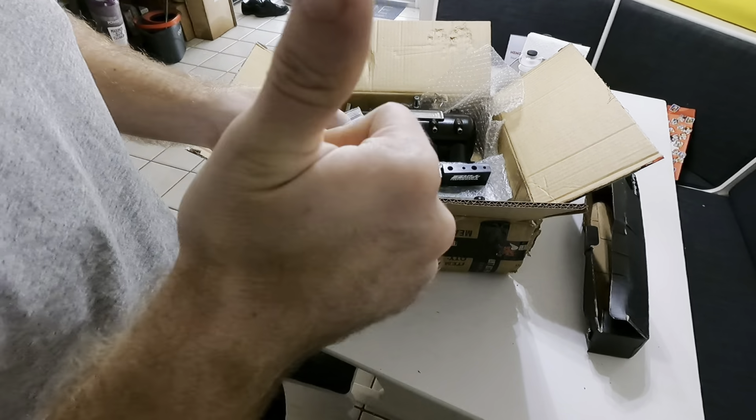I got it all mounted up to the intercooler. This is the only pipe that I have to cut to shorten to attach there. We even have clearance at the downpipe. This downpipe is going to get re-welded anyway. I'm going to contact a buddy and we're going to cut and weld and make that fit along with the dump tube so we can put AC back in the car. But for right now, it's easier just to have it out. That way he can do the modifications he has to do. Then we can put the AC compressor back on.